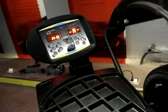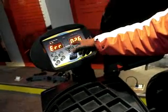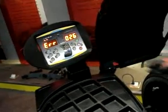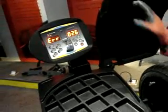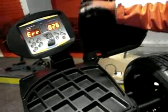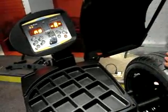So, we see that here comes an error again. Error 026 and shows no A. That means the pickup sensor A value, no signal. So we need to go and do diagnostics that why it will have this error code 026 during the machine calibration. Okay.